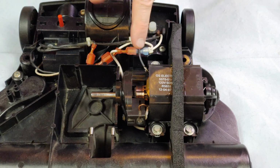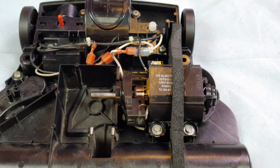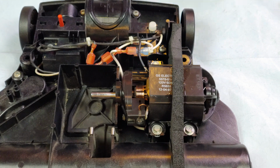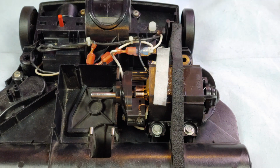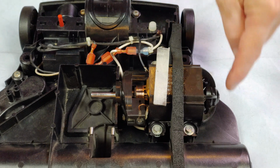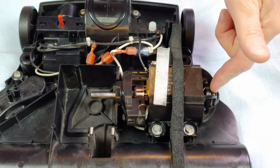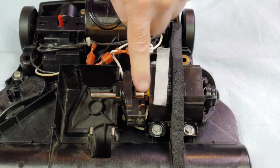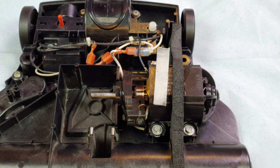That is super nice. That is really super nice. And did you hear the RPM increase after I reseated everything with the seating stone right there? So yeah, considering that the vast majority of this motor is from 1997, that's in really good shape. So obviously a massively re-oiled bearing here and a replaced bearing here. Original carbon brushes as far as I can tell.